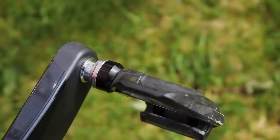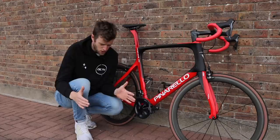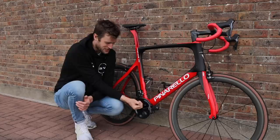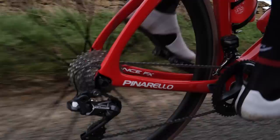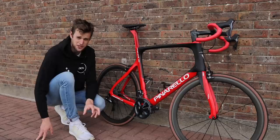I preferred this for a few reasons. I think it gave me a bit more power. I felt a lot more comfortable because my stance widened — when my pedals were closer to the cranks, I felt quite restricted in my pedaling motion and my knees would often come out. Also, because my feet were so big, they would actually hit the cranks on every pedal stroke because my heel was so far back. It would also hit the back of the frame. I always brought the pedals out, gave me a bit more room at the back of the frame, and I could get my cleat set up in the right position without hitting the frame and rubbing it.